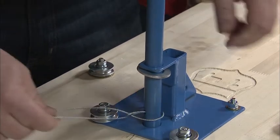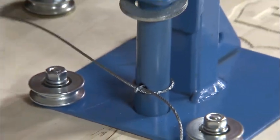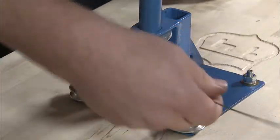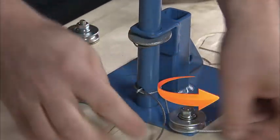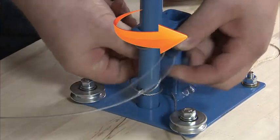Center the steering wheel and temporarily clamp or have somebody hold it to keep it from turning. Now take this cable and go around the shaft 180 degrees and head over to the pulley on the left side of the floorboard. The other cable heads around the opposite direction over to the other pulley.